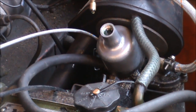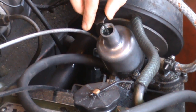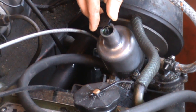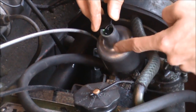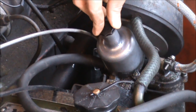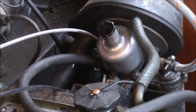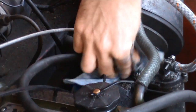So that's now at the bottom of the threads. When you come to put it back in, just let it go down, let it find the centre, then very slowly allow it to go back in. Don't force it, just allow it to very slowly go back in — it'll start getting easier and easier until you get towards the bottom. I've actually filled this a tiny little bit — you can see the oil is just starting to come out. That's okay, you can wipe that off. Once it's down to the threads for the cap, just wind it in — it only needs to be finger tight. Give it a little clean for any excess oil. And that is how you top up your dashpot for your carburettor.